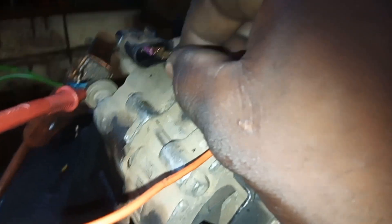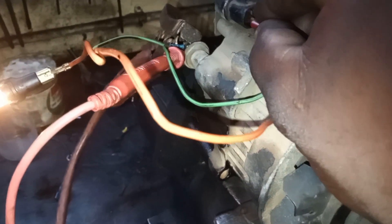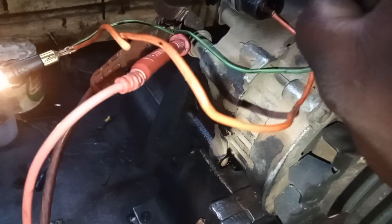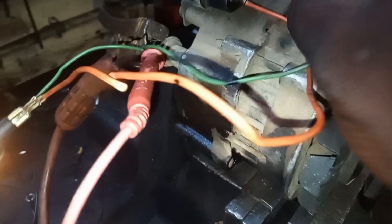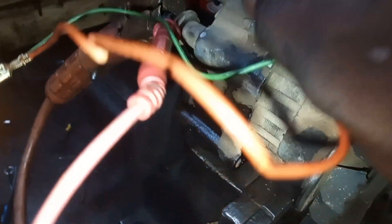Now I'm going to just put the light — you see it's got a warning light. So inside the plug there's a terminal. I'm putting one side there and the light is on. One side always has ignition — normally we have ignition here. Sometimes if you don't put this pin in, the alternator can overcharge. Some alternators they can overcharge if you don't put this pin in.